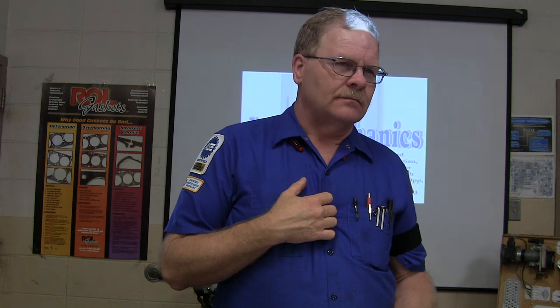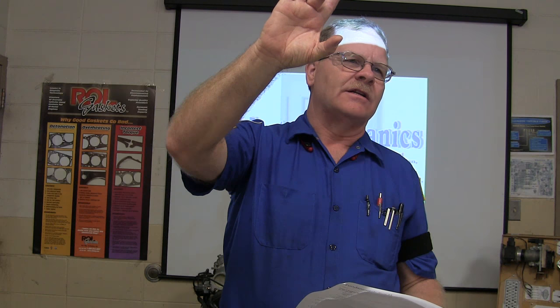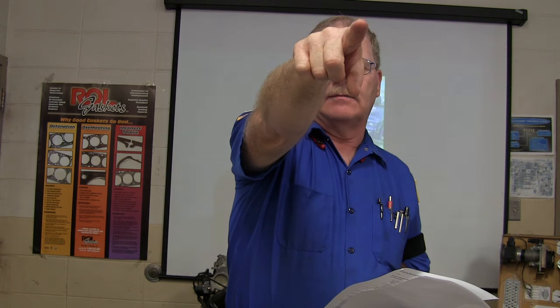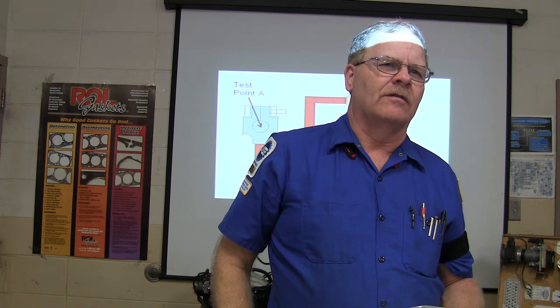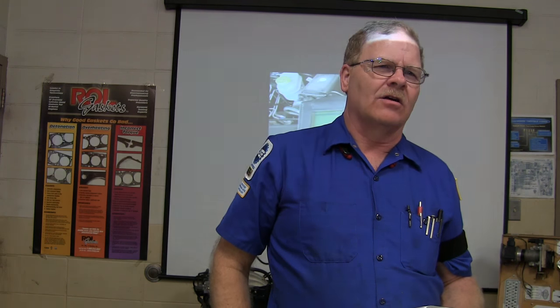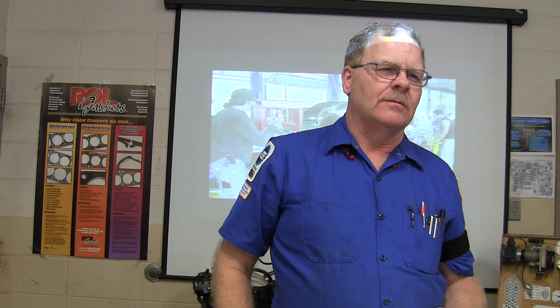It's got that little canister thingy that compensates for E85 underneath it. It's basically a fuel compensation sensor. Yeah, that thing. See that muddy thing? That's it. That's a fuel compensation sensor off of a Chevy. It's basically supposed to tell the PCM how much alcohol is in the fuel so it can change the fuel strategy. If you buy one of those at the GM dealer, it's $700.